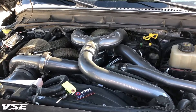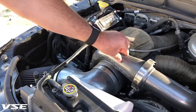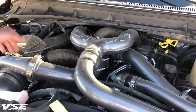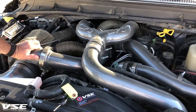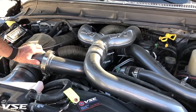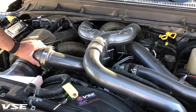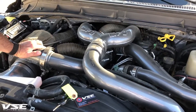On the cold air side, the truck takes a suction from the atmosphere here. The name of the game behind this turbocharger's cold side is to increase the net positive suction head that the 2015 turbo has. Typically without the compound turbo, this turbo would have to raise pressure from today's roughly 14.2 psi absolute — about one bar here in Nebraska at around 1,100 feet elevation — up to our desired target boost pressure of 28 to 34 psi.